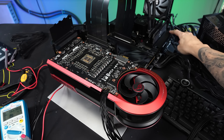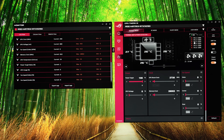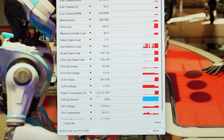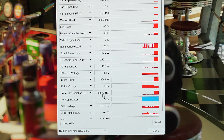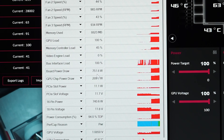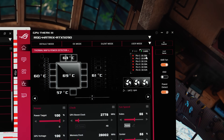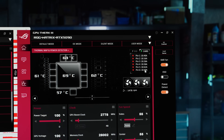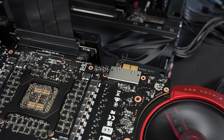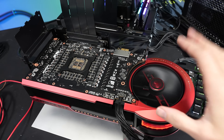Plugging it in — it boots, definitely booting. GPU Tweak is still complaining because there's no current from the motherboard side, but it is actually working. Power draw is about 700 watts, TDP showing 85 to 90 percent — we definitely fooled the card. Adding an overclock pushes it to 750 watts, confirmed in GPU Tweak. While nothing is being pulled over the motherboard side, switching to the card view shows a quite even but very high power draw of over 10 amps per pin on the 12V high power connector. In conclusion, our DIY adapter works as intended, and we didn't modify the card itself — we could just unplug this and use the card without any modification; it would not be detectable.